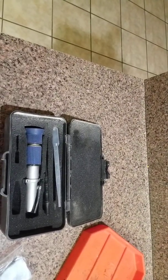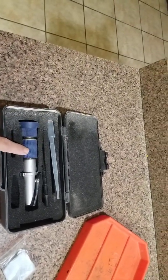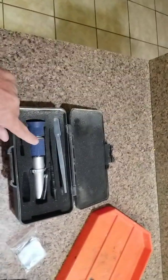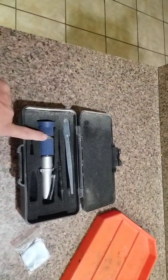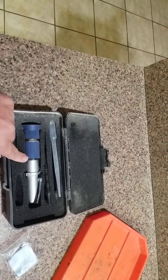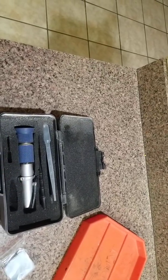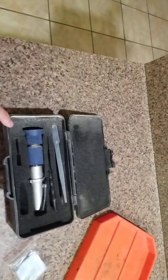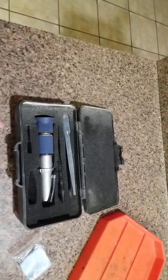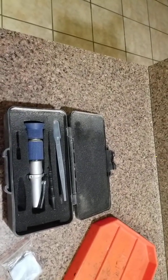But one of the other things this tool cannot tell you is contamination. By contamination, yes, there's cross-contamination of fluids like hydraulic or diesel, or even guys that put water just to get the low DEF light to turn off so they can get to the service station. Then they can buy DEF and top it off. You know what I mean? We've had a few of those. They'll put water and degrade the concentration, and that's how you find it with this tool. And then you usually have to drain the whole contents anyway.